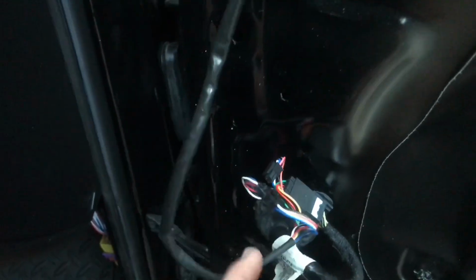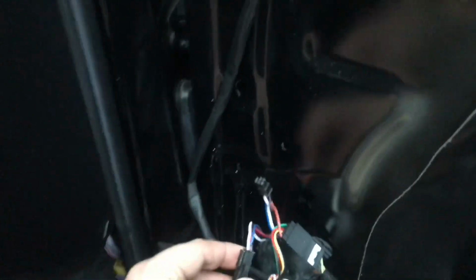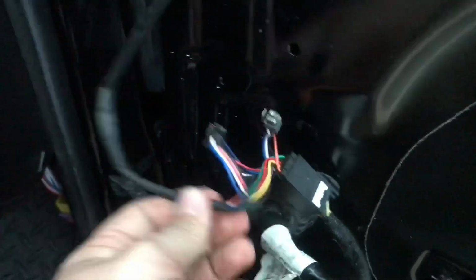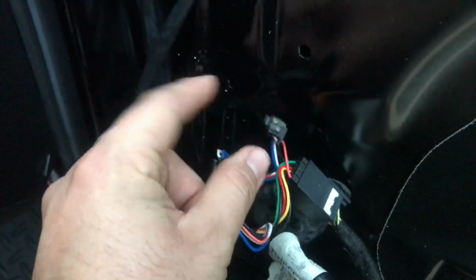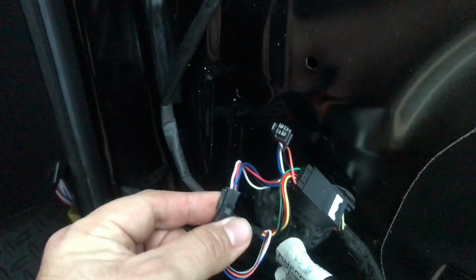Side arm, as you can see, looks pretty damn good. And I got the wire connected, just connects right there where the stock one, original went. And then you got this wire. Well, if your truck originally had running lights and the blinkers, you would just plug this wire right here coming out of the mirror into here. But if you don't, they do provide you another wire.